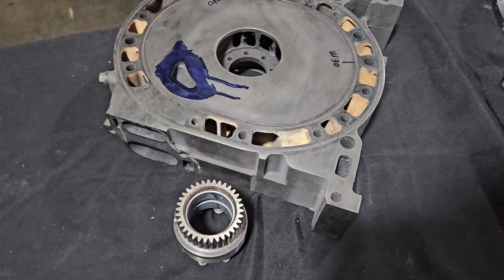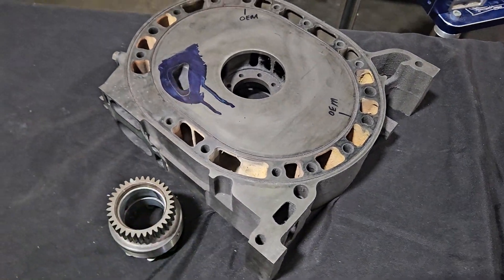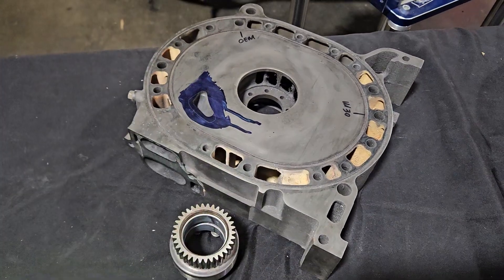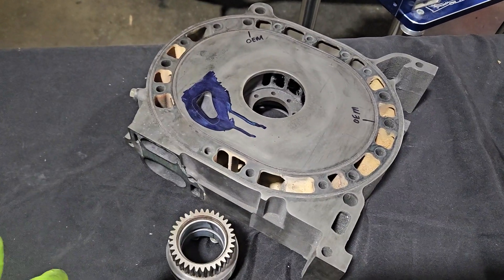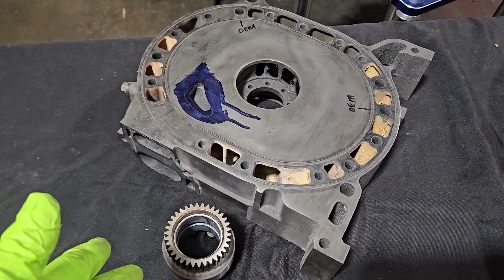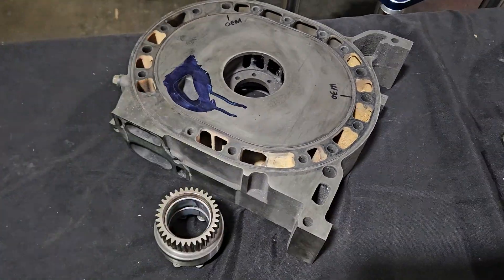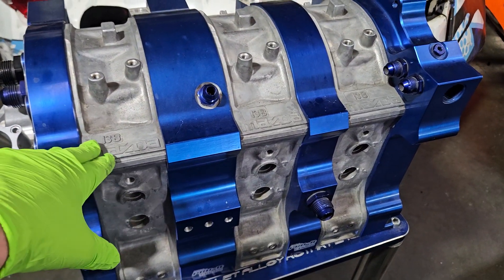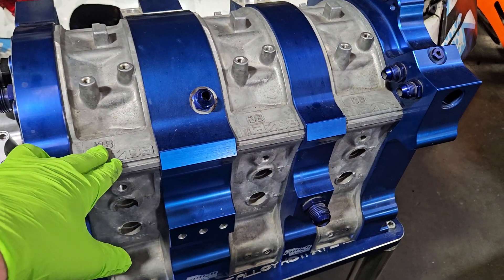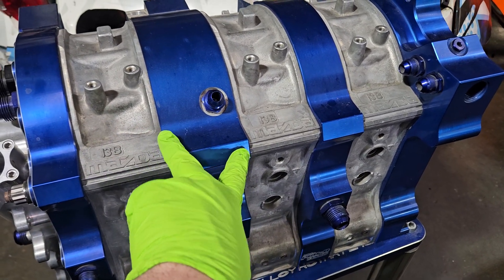It's actually a pretty strong component — still considered one of the weaker links in a three-rotor — but when you're talking about pushing a thousand horsepower drifting, 1500-1800-plus in drag racing, and I've heard of people getting 2000-plus horsepower before starting to break shafts and plates and components. Beyond that, you've got billet components designed for racing that continue to utilize the thick plate design because of its inherent strength.